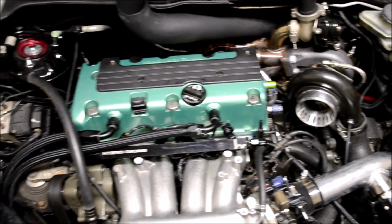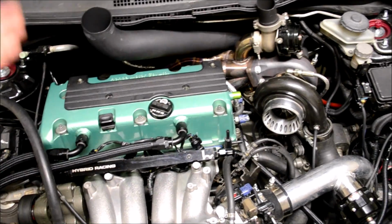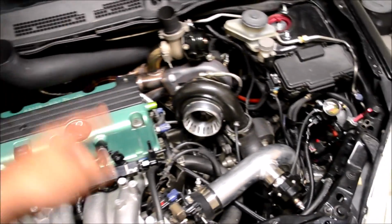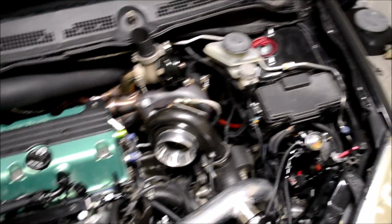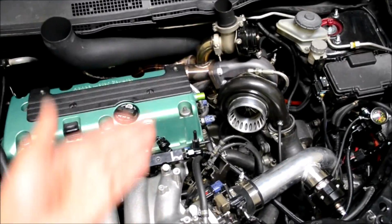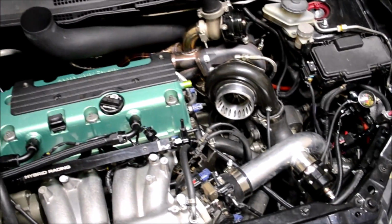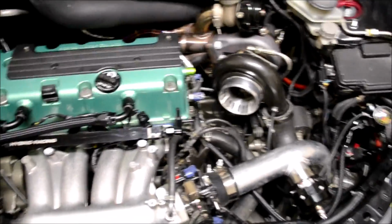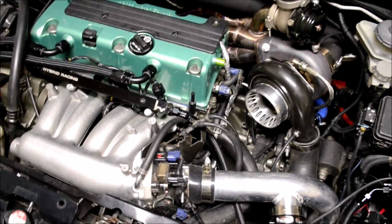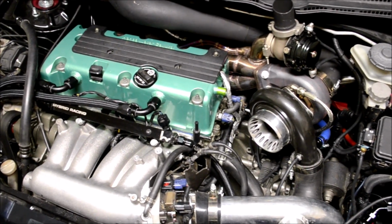All right, let's see. Valve cover, custom turbo manifold with twin wastegates. One wastegate comes out the hood, the other wastegate's back there, goes out the fender. El Cheapo turbo, El Cheapo wastegates. Custom made the exhaust out of the back. And we keep moving over. Everything else is an upgraded map sensor because you need that for turbo.